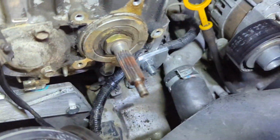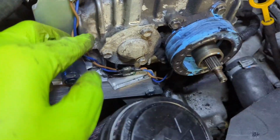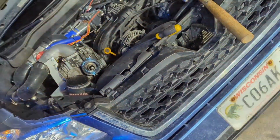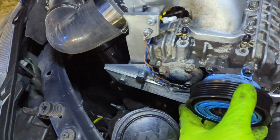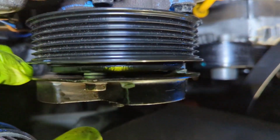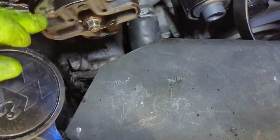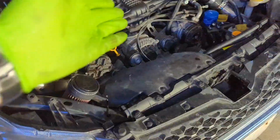A lot of gunk, but yeah, under the flange it looks pretty good. Okay, magnet is plugged in, wired up. Next is the pulley. There we go. I got it reinstalled without the shim. And that clearance is more what I expected. Pulley can still spin freely. And yeah, at this point it's fully reassembled, just the belt left to go.